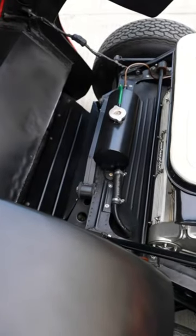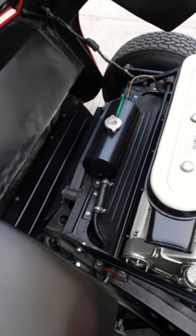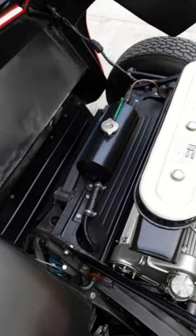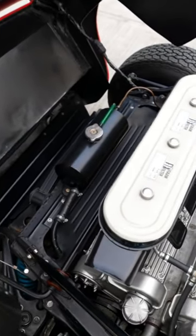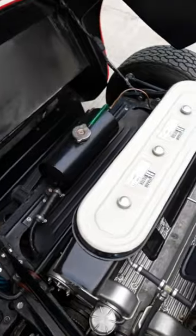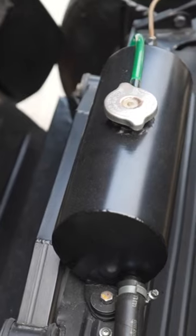This configuration necessitated Lamborghini to design the engine and gearbox into a single transaxle, which was mounted behind the engine itself. This design was very unique — it meant they had to do away with a flywheel, and they used the inertia and the mass of the gear mechanism to balance the engine.